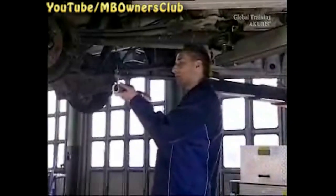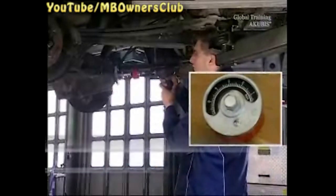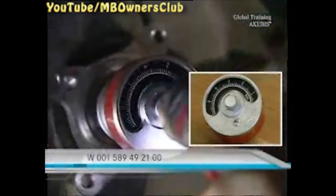After the repair, the axle gear may not show a substantially higher frictional resistance than before. Now, therefore, determine the frictional torque. Turn the measuring instrument at a speed of about one rotation per second. After the fifth rotation, read the value while turning. We have a value of 1 Nm. Make a note of your value for comparison after the repair.